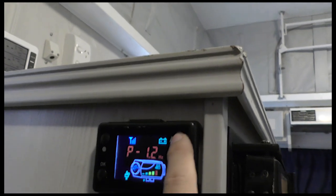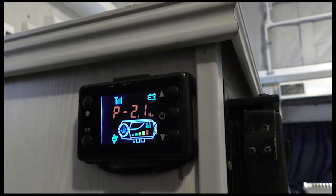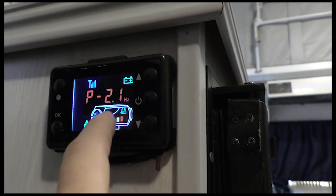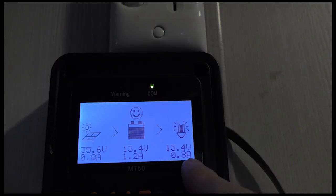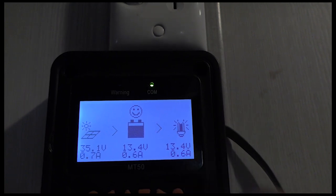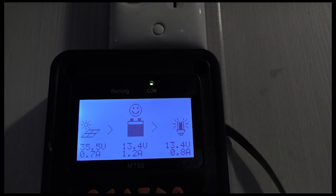If you want to ramp the thing up, you can just bump it up. You will get used to these settings and what they mean. Turning up the frequency — which is effectively turning up the speed of the fuel pump — you'll see the fan tends to pick up just a little bit as well, and I can hear the pump going a little bit quicker. That's gone up to 0.8 of an amp, fluctuating between 0.5 and 0.8. So the lower the setting you use, the lower the heating output, and the less power it pulls to run that pump and fan.